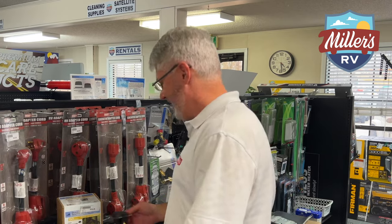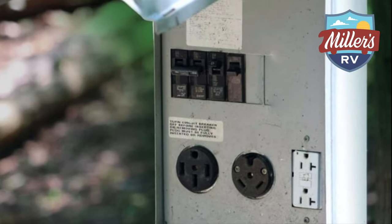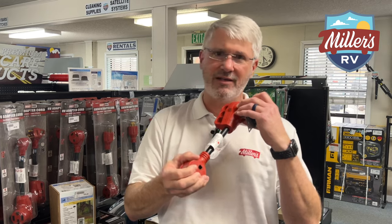Okay, here's the answer. If you're talking about a 50 amp outlet at an RV campground — one that comes in a box, the outlet looks something like this — then yes, you absolutely can. We have an adapter that is a 50 to a 30 amp adapter. It has a 50 amp plug that plugs right into here, and then your 30 amp cord plugs right into here, and your coach is going to work perfectly fine. It's not going to hurt anything.